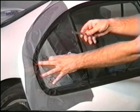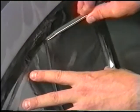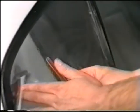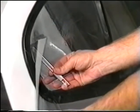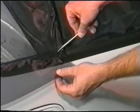Poke your finger into the gasket, and with your knife in the one-click position, insert the blade against the gasket and slowly begin to cut upward to the factory edge of the film. Gently tear the scrap away from the pattern. To finish the pattern, cut downward, smoothly following around the bottom of the gasket until you end up at the factory edge. Tear away the scrap.